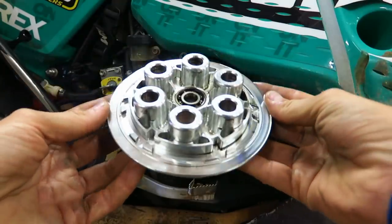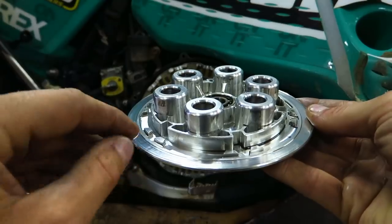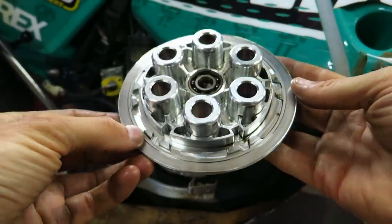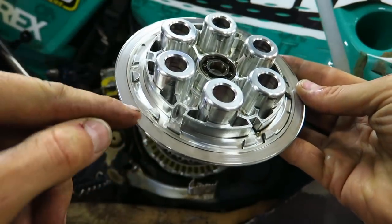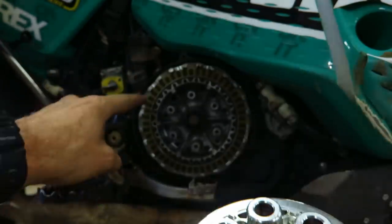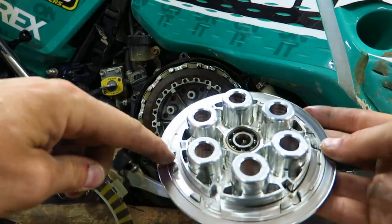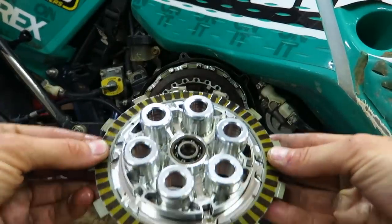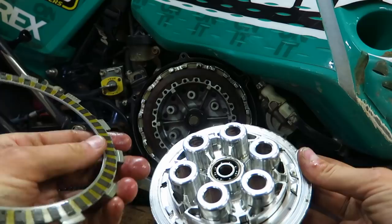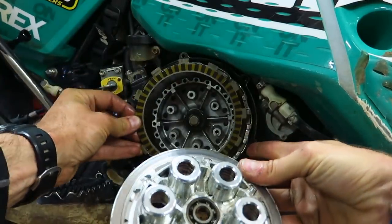Let me try and explain what's happened here. The clutch disc friction plate touches the pressure plate here, but you can see there's a groove all the way around the pressure plate. This pressure plate's done many thousands of kilometers and it's worn a groove around it. There's a lip on the inside and the outside, and that lip is now the depth of the material on the friction plate. So the metal part here is touching the pressure plate — metal to metal. You can see it's shiny on the inside. That's causing a lot of vibration. The clutch is not slipping, but obviously it's not good — it's taking pressure away from the clutch.